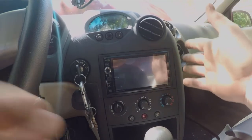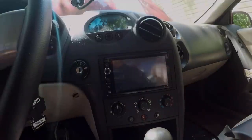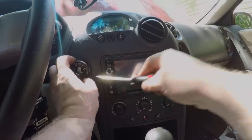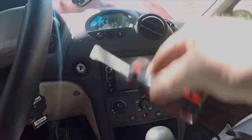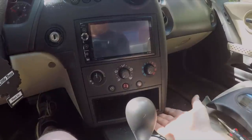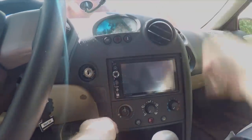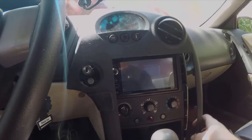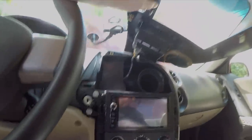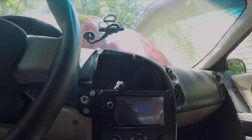For the final install — actually changing the DIC itself — this is surprisingly easy to do. Take your keys out and use a flathead screwdriver to get behind the surround for the key. Pop it forward — be very careful because it is plastic. The rest of this just snaps in. The trick is to be really careful not to break it. Start down here and just pull it loose all the way around as you go until you get to the other corner. Once it's loose, rotate it to get it around the shifter and angle it up. Then there's just one connector right here that you unplug and you're done.